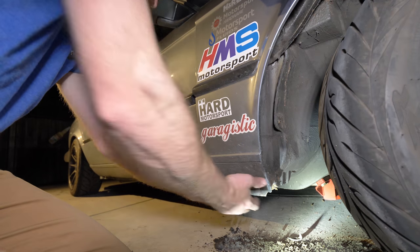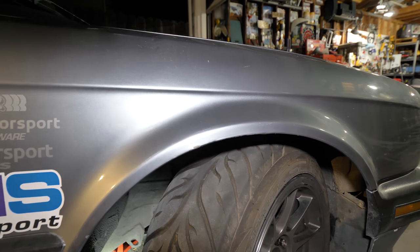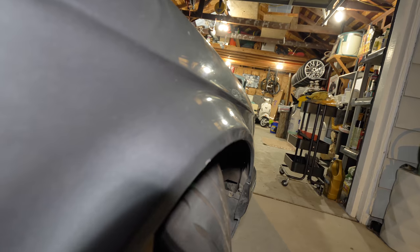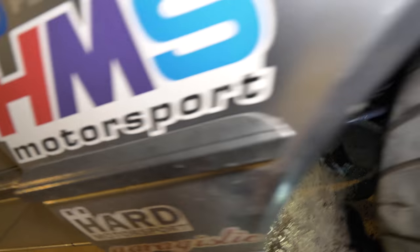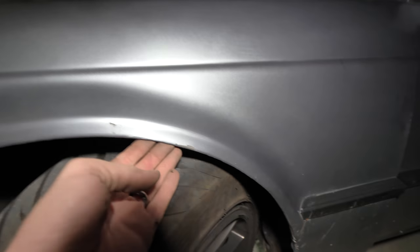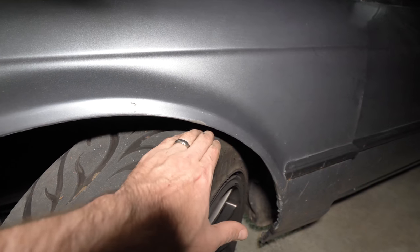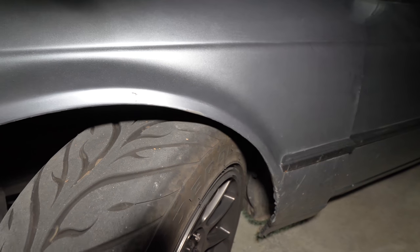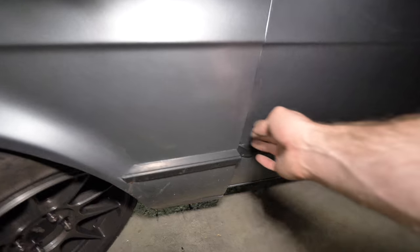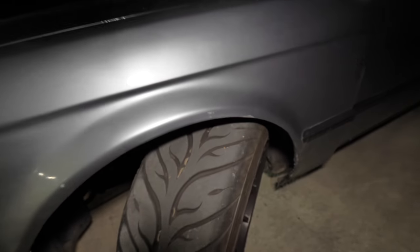What we're going to do is basically just space this thing out — I'm going to kick it out about this far. Watch my fender up here — kicking it out about that much adds quite a bit of extra clearance up in my fender. So I'm going to kick it out about an inch. Watch this side over here — I hit a little bit of fender before I did this because this is full lock, and if you get a bit of compression and suspension travel, boom, you're going to hit right here. That can happen when you're getting sideways, turning super hard under high G, high stress load of the suspension — you can load up and start whacking things. When this wasn't pulled out, you can see I have an extra inch — it is way closer to the tires. So that's why I'm doing this.